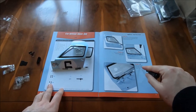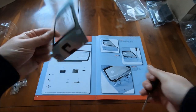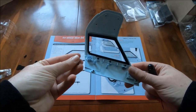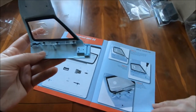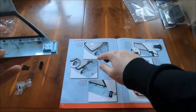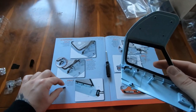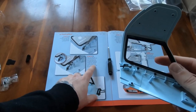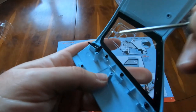Now we can move on to the next section, which is placing the opening mechanism — this little one here — into the recess on the door's interior face, into this little slot here. Then if we flip that around, place that through there. Step four: place the opening mechanism spring onto the rear part of the opening mechanism. Step five: place the opening mechanism plate — this little retainer — over the end, up against the spring, holding the assembly in place. Secure the opening mechanism to the plate with two FD04 screws.